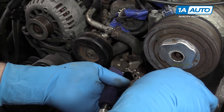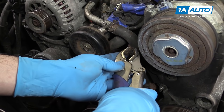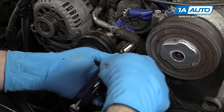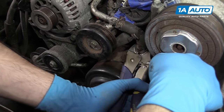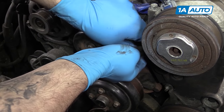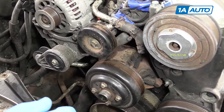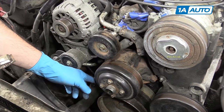Using a pair of locking jaw or other pliers, compress the clamp, move it off the end of the fitting for the water pump hose, clamp on there, twist it a little bit to free it up, and remove that from the water pump. Now the other one is pretty tricky to get at, so we'll do the bottom hose on our water pump the same way.